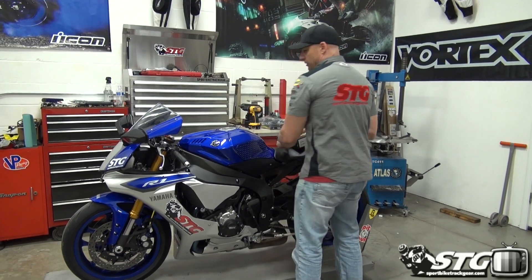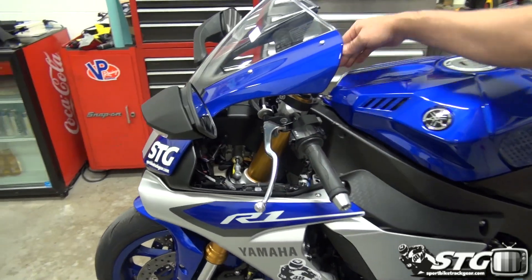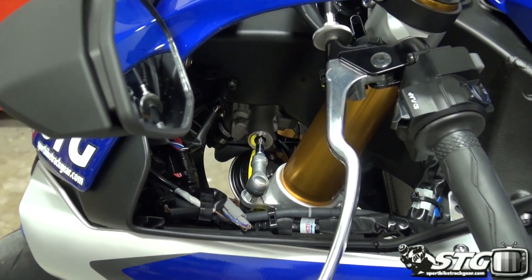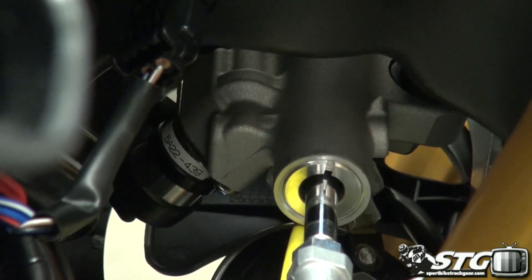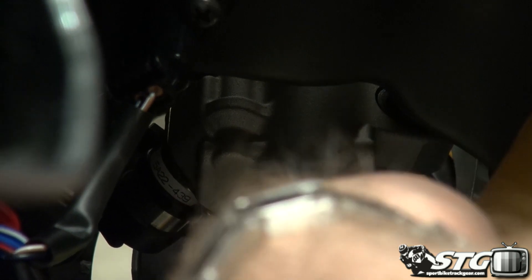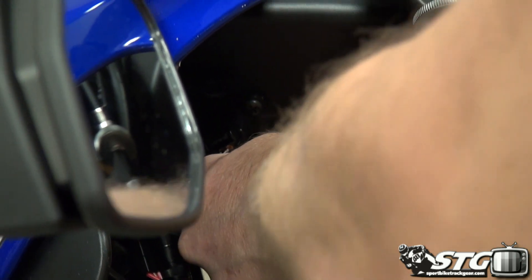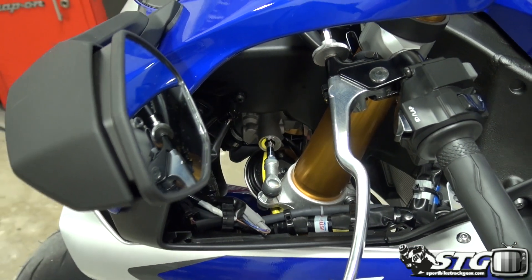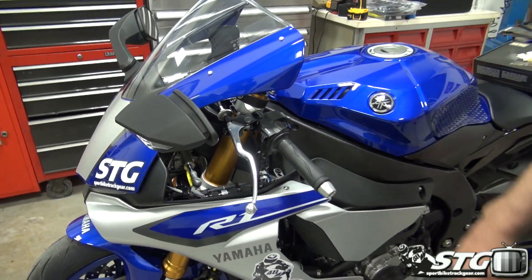This piece is located up here in the front of the bike. I've removed these two upper trim panels, these closeout panels, to give you all a better look at this and give myself a little more access to do the job. We're going to need to remove the mounting point here. There's another mounting point that is under the steering head area here. In order to do that, I'm going to raise the motorcycle up and remove some of the trim underneath.